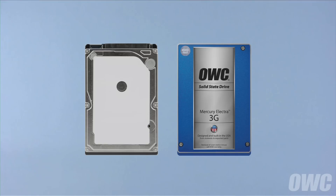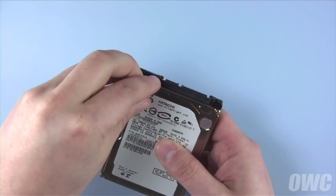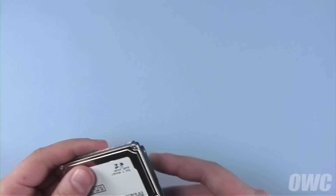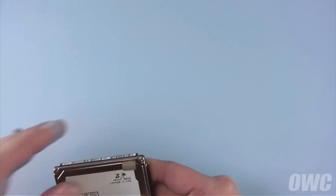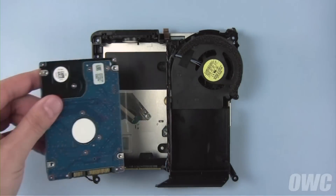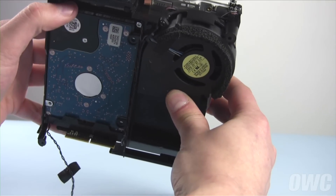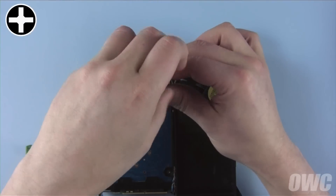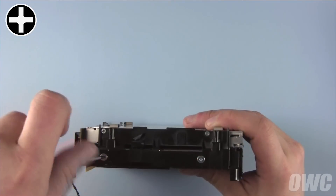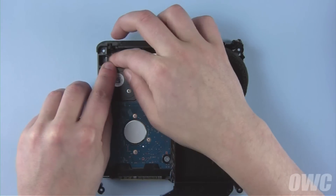You are now ready to install the new drive. We can install any SATA 2.5-inch platter-based or solid-state drive in the Mini. For this installation, we're going to install a standard hard drive. Place the two anti-static cushions you removed from the original drive into the same locations on the new drive. There should be enough residual adhesive on the pads to allow them to stick. Slide the drive back into its compartment. Then tip the assembly so that the drive is on the underside. You should now be able to slide the drive onto the SATA connector. Next, replace the four mounting screws that hold the drive in place. Finally, reattach the heat sensor. There should be enough adhesive left on the sensor to attach it to the drive.